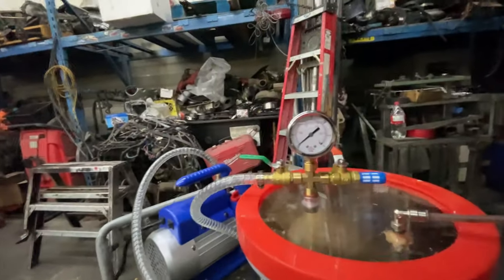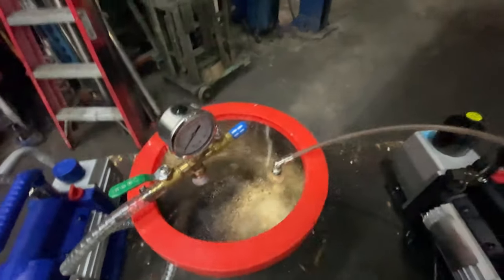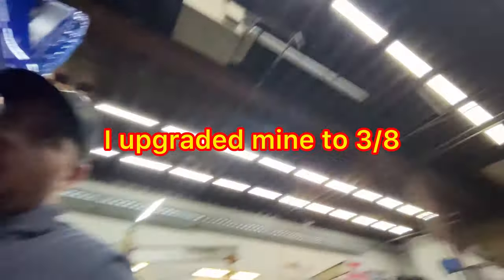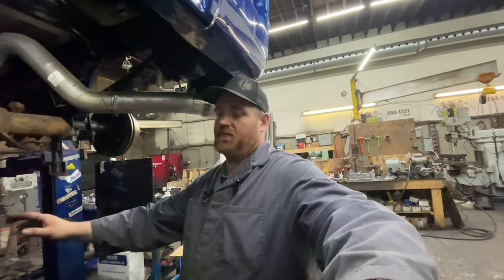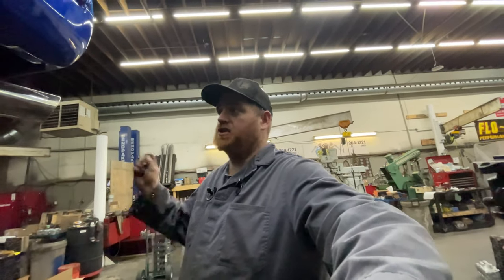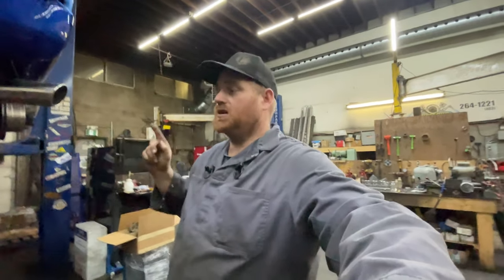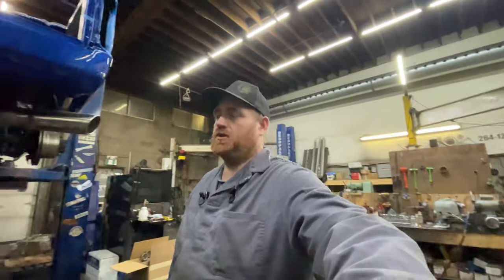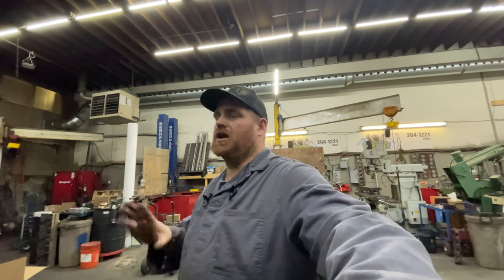It is pulling heavy vacuum — it's pulling like a good 28 inches. It's funny how when the oil comes in like that it goes foamy, but it is what it is. This is all I had — realistically this should be a bigger line. The bigger you make this line, the faster it's going to suck that in. If I was going to use this all the time, I would make this at least a three-eighths line, if not even bigger. If you get like a seven-sixteenths or half-inch line it's obviously going to move it faster. You know, one of those things — you want to empty a transfer case, you can stuff it in there if you can't get the plug out. Also, another thing you can use this for is bleeding brakes — you'd be able to use the same setup. I'll actually use this to bleed the brakes on this truck when we do it in another week or so.